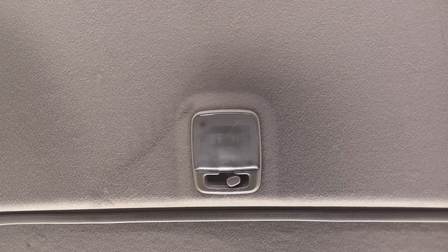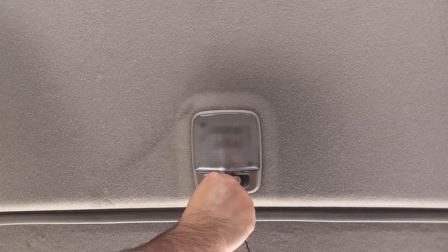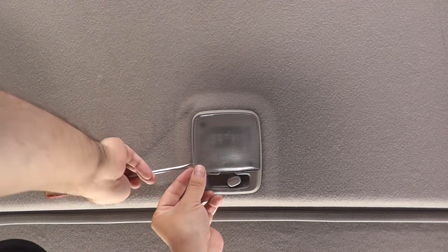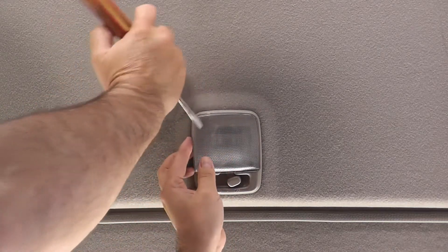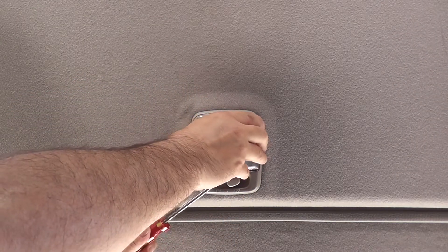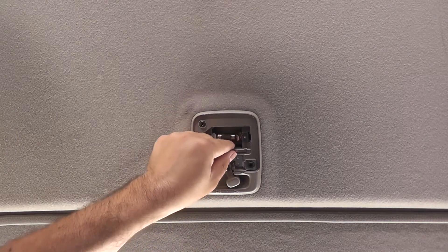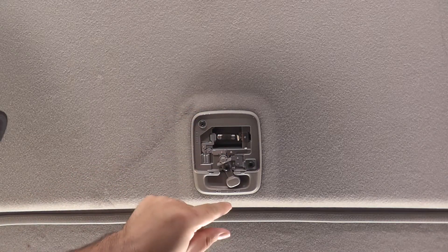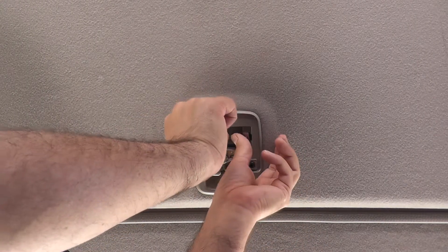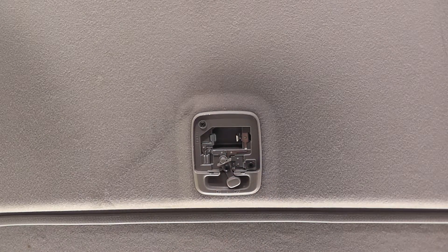In the middle seat you won't see a notch anywhere. What I do is go in near where the little switch is with your flathead, angle it to one side to release one side, then work around it and remove the other side to get the cover off. The bulb here is a 31mm festoon. Push it in one direction and then up to release it.